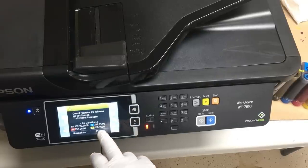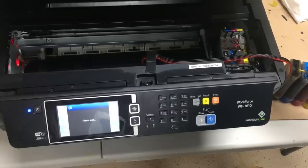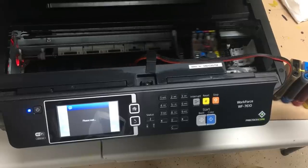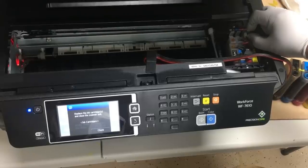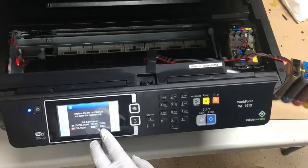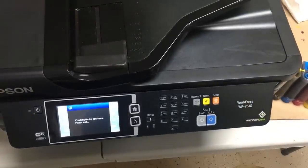Many people would open up the printer lid and start troubleshooting. The correct way is to click the proceed button and then open the lid. We'll wait till the cartridge comes to a stop, then press and hold the reset button on the CIS. The reset button will discontinue the electronic current on the chip temporarily. We can see as the button is pressed, the corresponding symbol on the LED screen is grayed out.